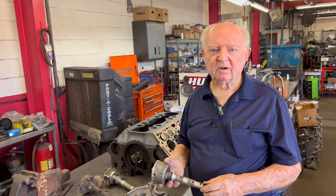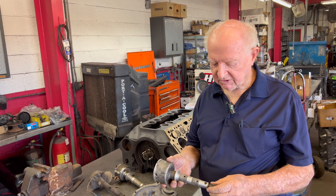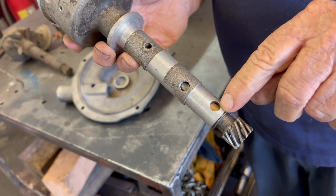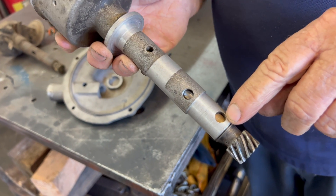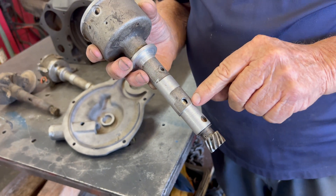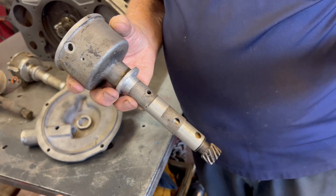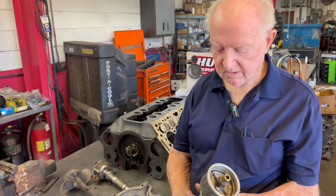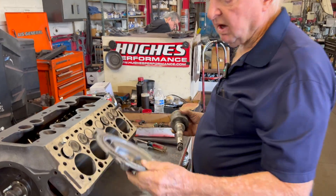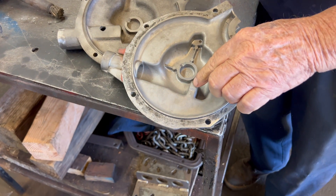All this is fairly reasonable instead of buying a six or seven hundred dollar distributor. We just turned a Chevrolet one. When I changed the bushing and put it back in, the bushing had plugged the oil hole. Oil comes off the timing chain, splashes into that hole, and oils the bushing - so you have to make sure that hole stays open.